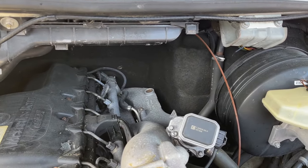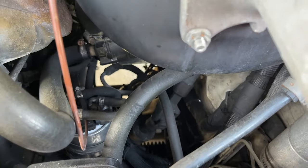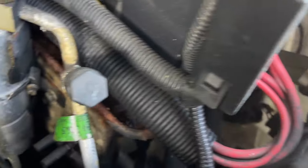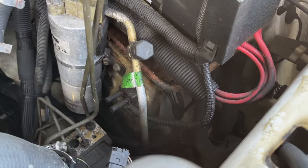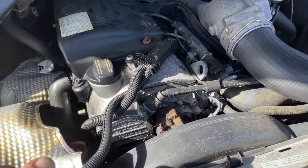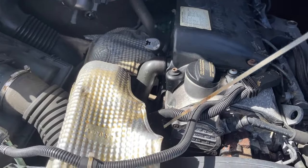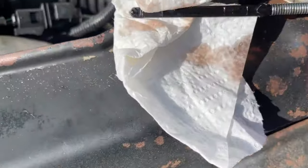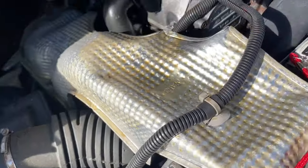I've driven a lot of them that have softer brakes. Pierburg EGR, so that's not gonna be very old. That's good. Fuel filter looks kind of old, but not rusty. So it's been maintained. Got some kind of secondary electrical system that's been removed. Still got a wire going to it, but nothing coming from it. Golden brown there. Transmission fluid is still nice and red. Motor oil is golden brown, fresh from an oil change.